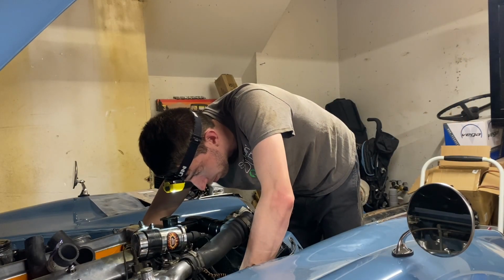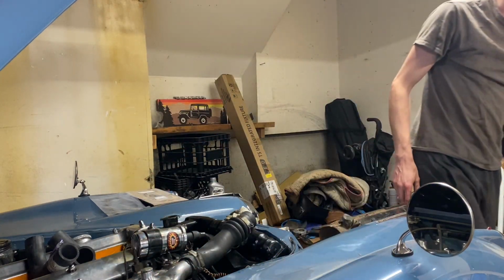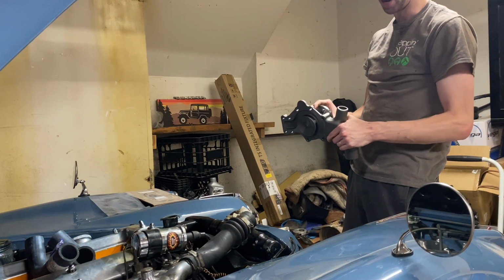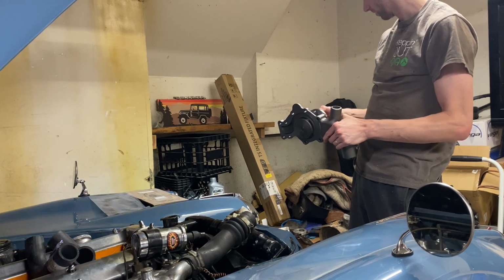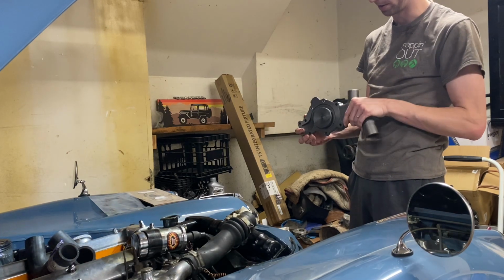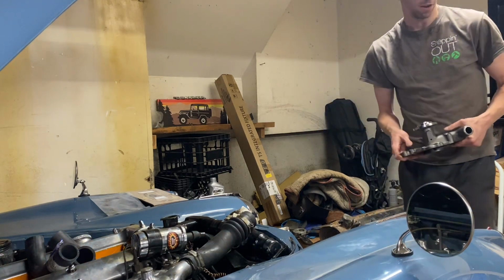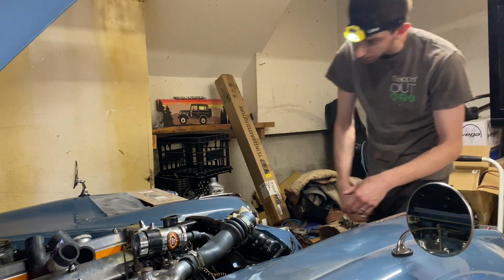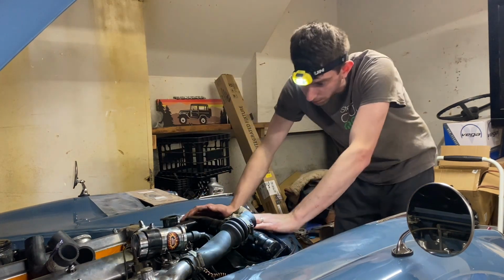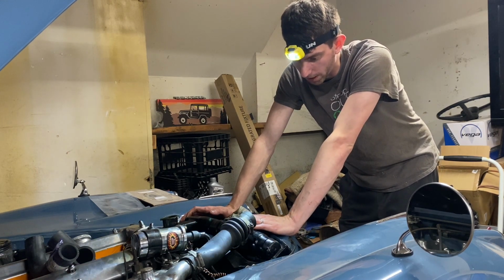The concept for changing the water pump is really simple on these cars. It is mounted right to the front. Basically, the water pump just sits bolted to the front of the engine, and on the front of this, it has a V-belt connection, and then that connects to the fan, which is direct drive, and it's always on, so there's no fan clutch or anything. It really can't be much simpler than this. The only complexity is the car itself, the tight locations, and just making sure you are doing everything properly and carefully.